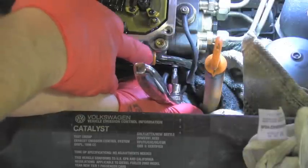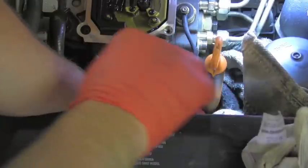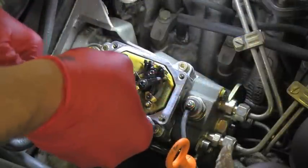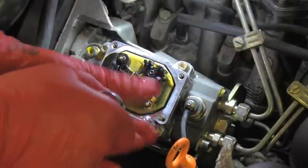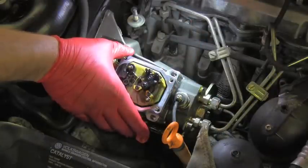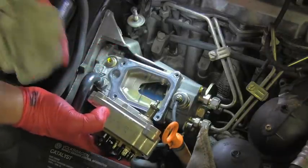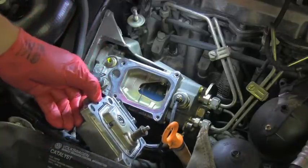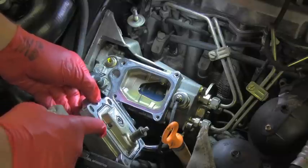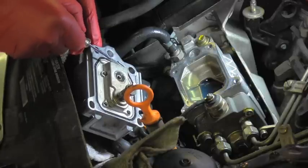To have some play for this cable I will remove that bolt on the bracket down there — it's a Torx T25. I will continue with removing these three T30 bolts and I'm ready to move away the adjuster. Now we can see the gasket which we are going to replace, it's right here. Now I'm ready to remove the second rubber gasket.